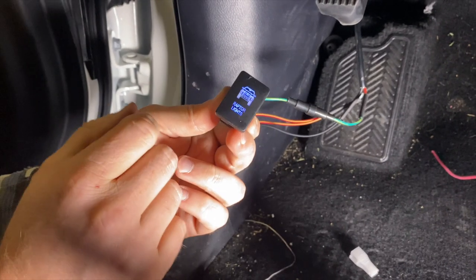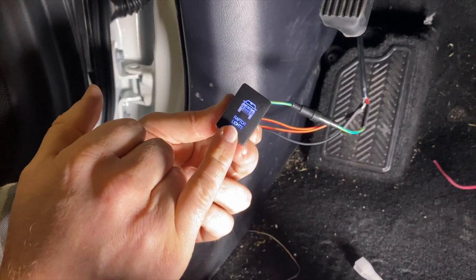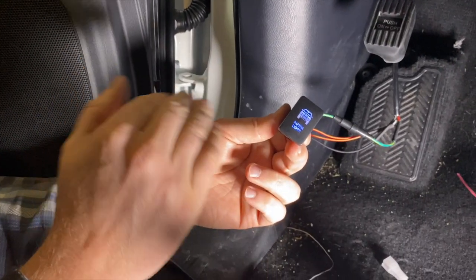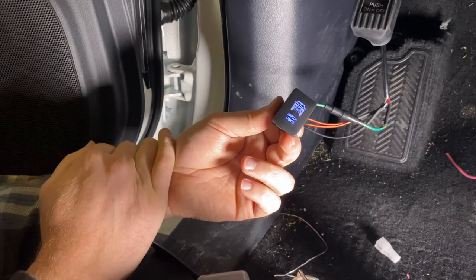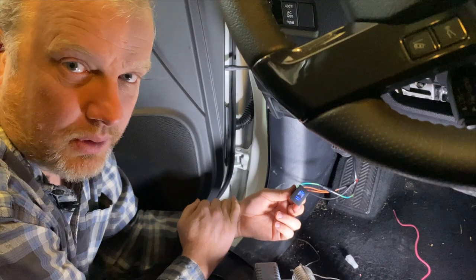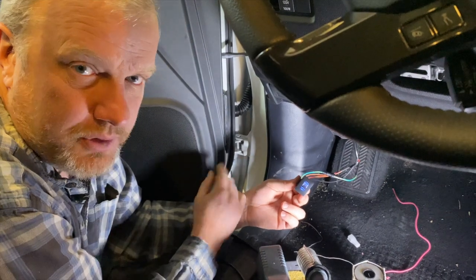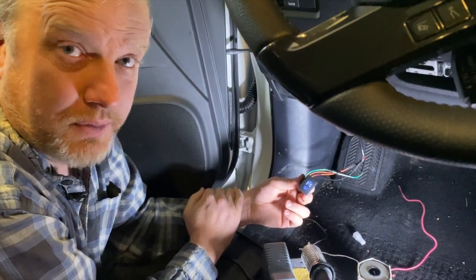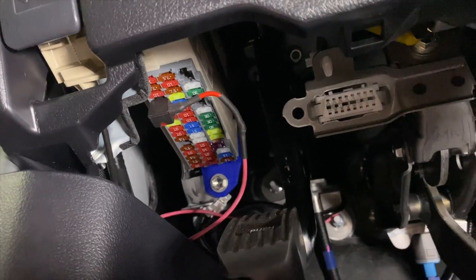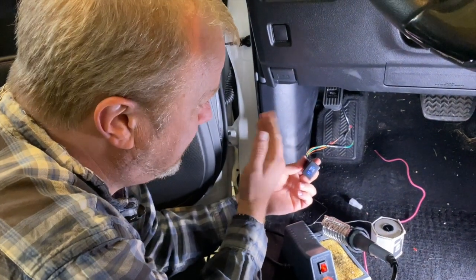You could wire the two reds separately so the raptor light text illuminates independently from the truck graphic — for example tied to the headlights as a dim backlight. We chose not to cut into any factory wiring since it's a brand-new vehicle, to avoid any warranty concerns. Everything is independent wiring, and the add-a-fuse can simply be unplugged. We haven't cut any factory wires — the only modification was a hole in the grommet, which we siliconed up.